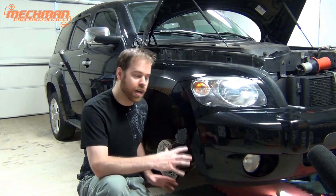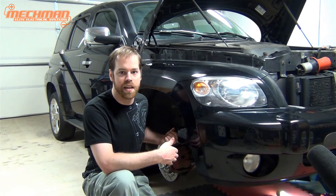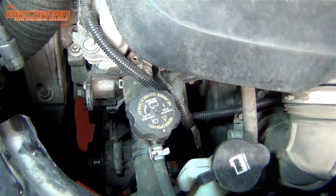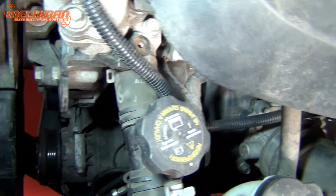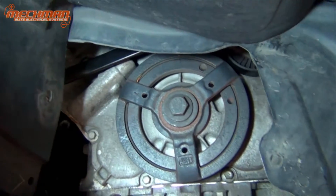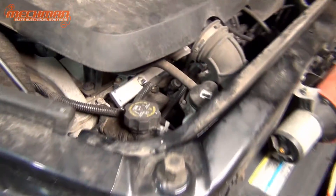It's a good idea to get a repair manual for your car to know the exact procedure for how to replace your alternator. The HHR engine is quite cramped in there, so we've had to take the wheel off and take out the plastic shrouds underneath to be able to reach the tensioner pulley and the alternator itself. The factory alternator was located in a tight spot right above the air conditioner and connected with the serpentine belt — I had to access it from both top and bottom. You can see the pulleys there where the belt wrapped around, and I had to extract it from the top.